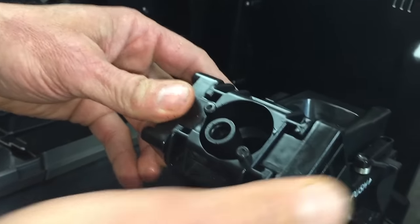Now to getting it back in the machine — it's possible while you were doing this that the brew group position moved. To put it back into the machine, this has to be in its home position, which is all the way up. You'll see an arrow there and an arrow there — they have to line up. If for some reason you can't get it in, you may have to push on the press button. In fact, before you put it in it's a good idea to press that — it gets it in its ready position. Then just lock it in and give a little pull to make sure it's in place.